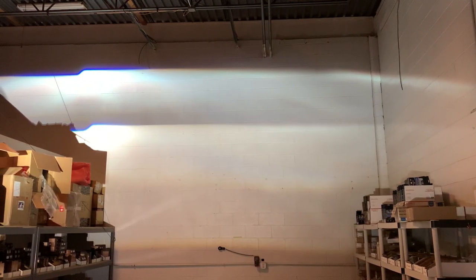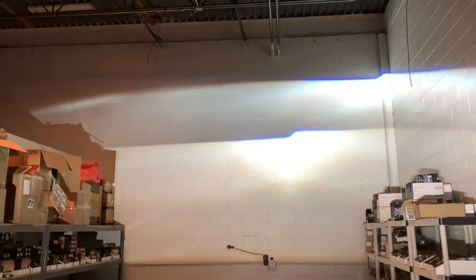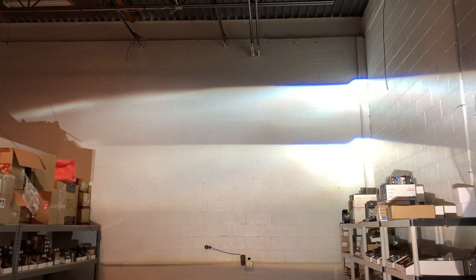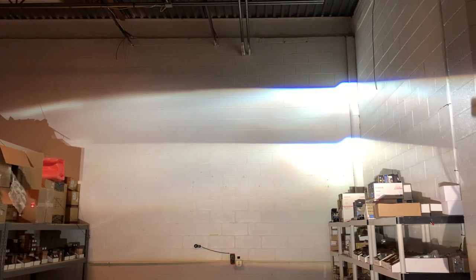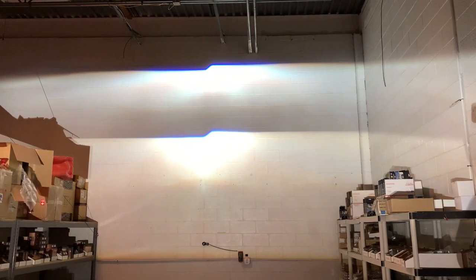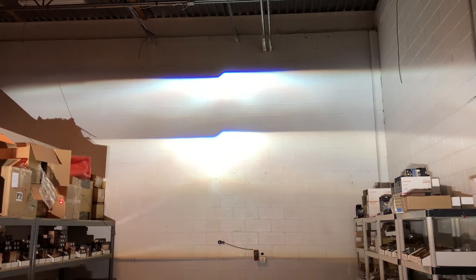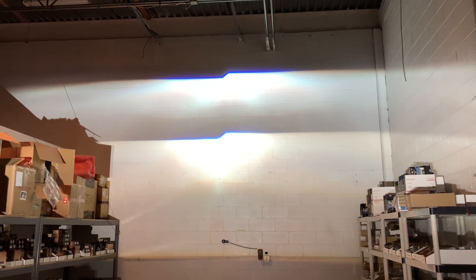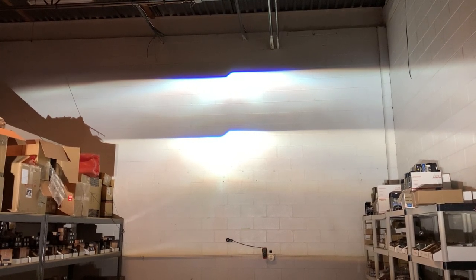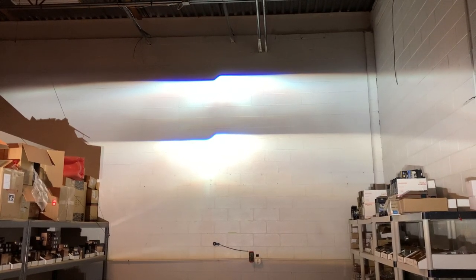If we look at the extreme edges of the beam pattern, you can see the D2S Micro carries over really, really cleanly and straight, versus the G5R — and this is the same thing on the BRT and on the EXL — it sort of dies off a little bit. To most customers it's not a big deal, but we do have some customers that complain they really don't like the bowing; they love the performance but just don't like the bowing. This is a really impressive performance out of that small compact unit, due primarily to the design — it's really sharp, really nice — but mostly to the use of OEM bulbs.